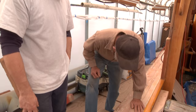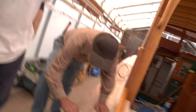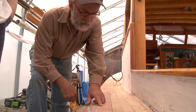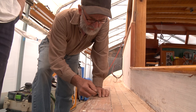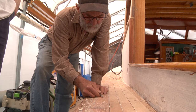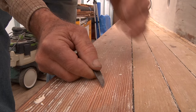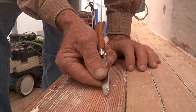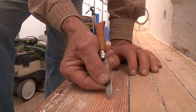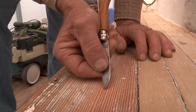What type of wood is it? Let's take a look. I'm going to do a little scraping here, not to alter the shape at all, just so I can look at the wood a little bit easier. I would say that this covering board right here is Douglas fir. The reason I say that is by the appearance of the grain — the annual rings are quarter sawn and coming right up at you. The width of the harder rings and the soft rings tells me this is fir. This is a very soft grain line here, and this is very hard.